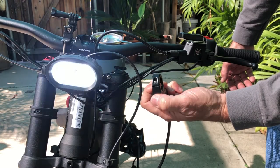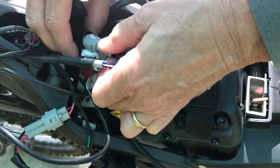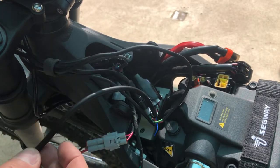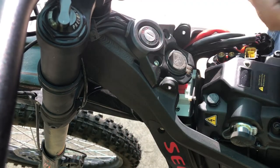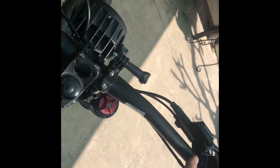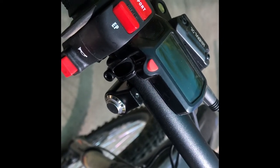So far, so good. Now we're going to go ahead and put all the wires and plugs back into the little protective coatings and stick them back in the channel to make room so that we can put the ignition back in. We're also going to bundle these wires and make sure they can fit in that little cutout where all the wires are coming out. There's an extra wire in there so there's not a lot of extra room — you really have to work to get those in there so none of them get pinched. I was going to mount the switch on the right side but thought it might interfere with the throttle, so I mounted it over with all the other controls to make it easy so they'd all be in one location.